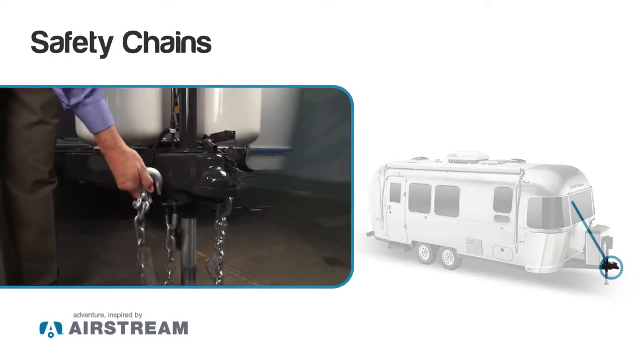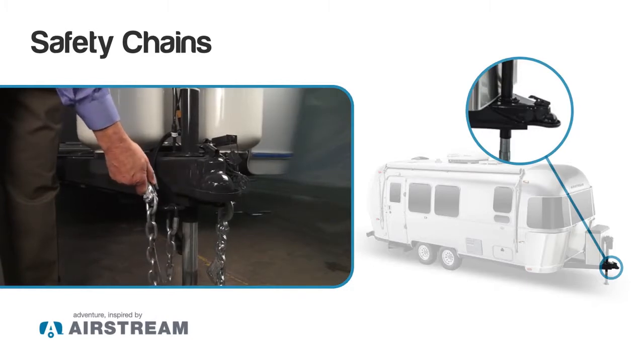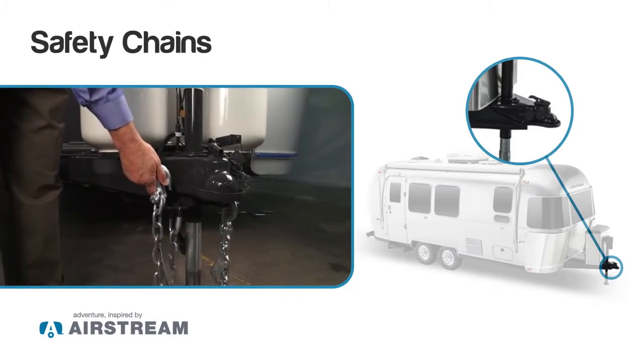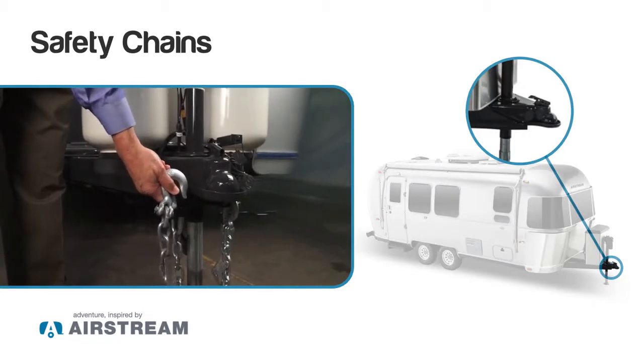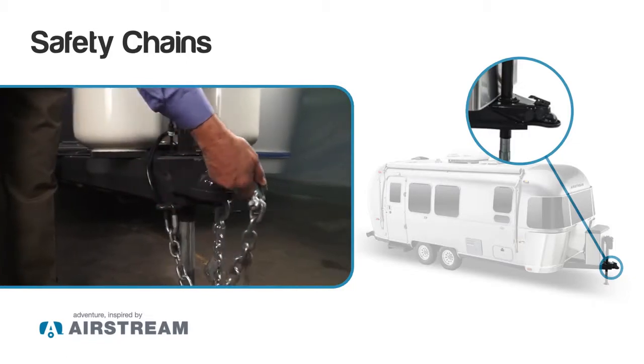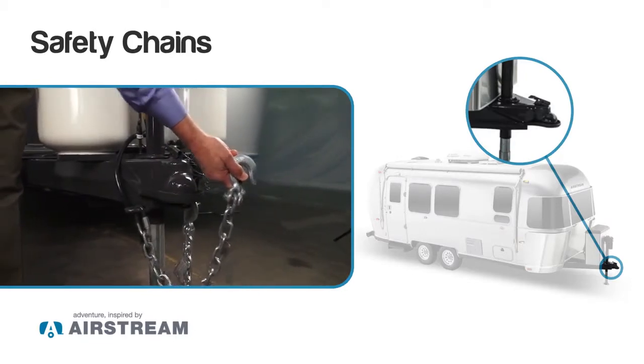Next we want to talk about the safety chain that comes with the trailer. There's 2 of them. The purpose is in case of your trailer coming off the tow vehicle, that it will catch the trailer before it hits the ground. The chains are to be crisscrossed, attaching to the tow vehicle, acting as a cradle.